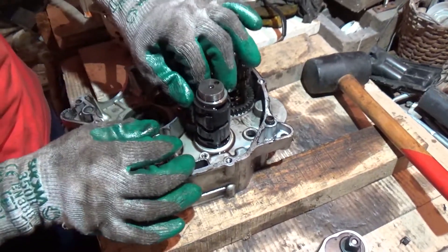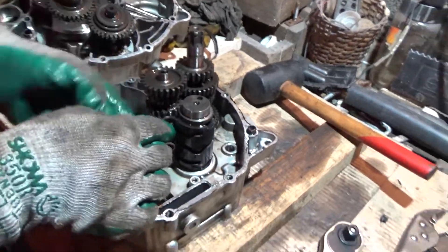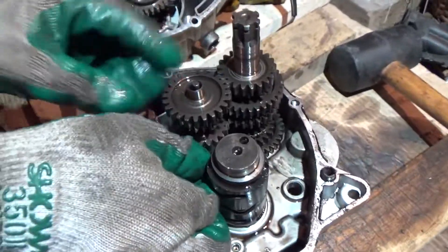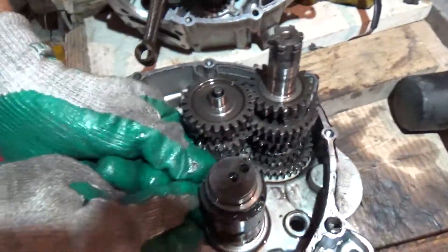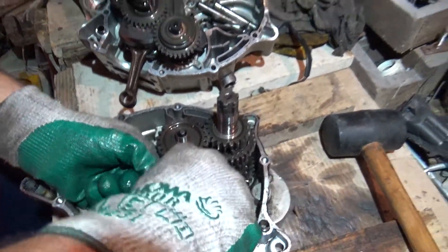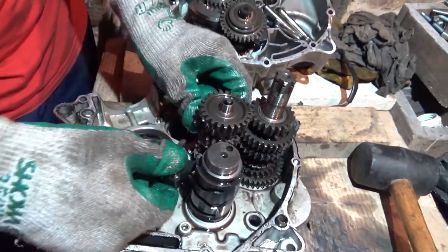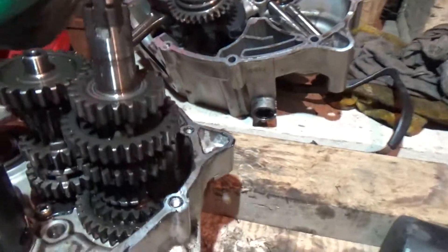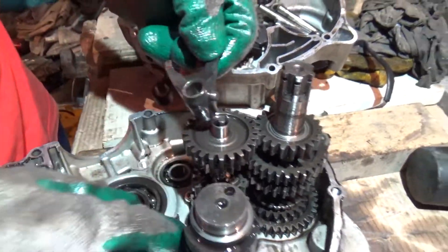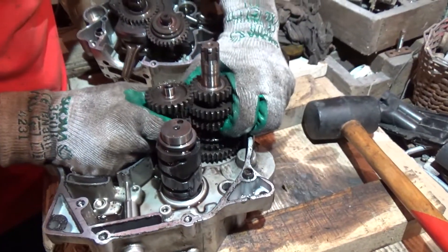Now I'm going to pull this one here. This is smaller, for the primary. And I got the gear selector. So let me change the gear — popped out. And this one was here, and that's the one which is C. So C, the smallest one, is for the primary shaft. Now I'm going to try and pull the gearbox out.